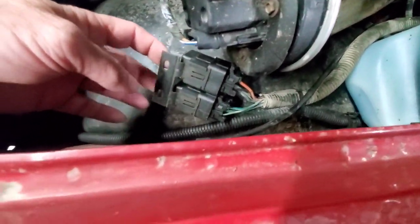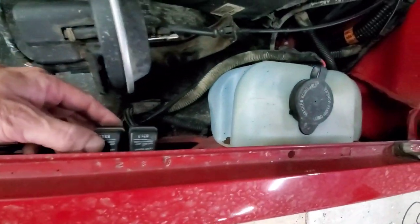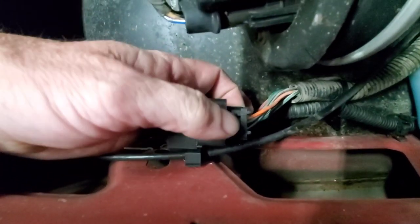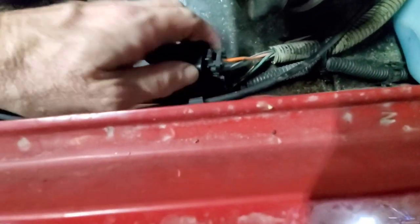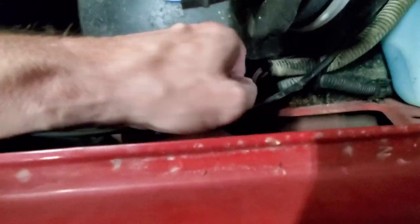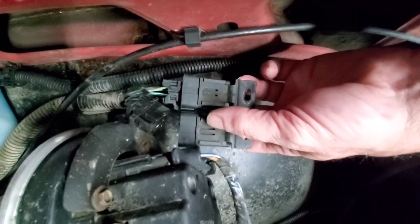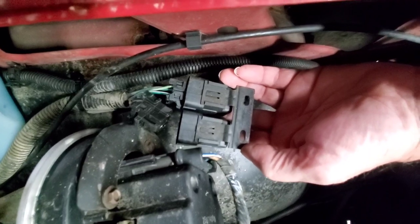In order to see what I was doing, I went ahead and pulled off — I think it was two 7mm screws that hold this whole bracket. Goes right there. There's your washer reservoir. Anyway, that little button right there is how you get it out — you push down on there as you pull out. I'm not going to be able to do this one-handed, but it comes out just by pushing right there. And in order to get this out, you're going to need a little flat blade and pry that center of that clip right there up, because you need this plastic piece to go towards my hand.